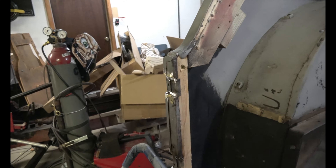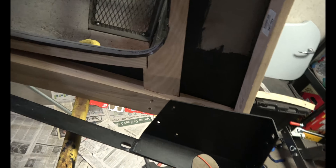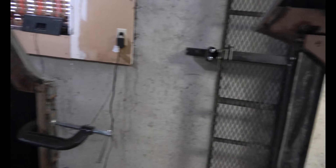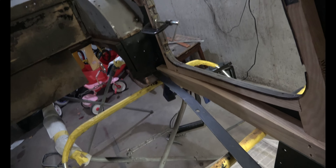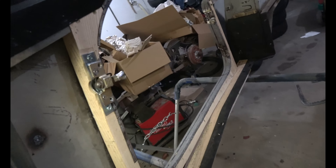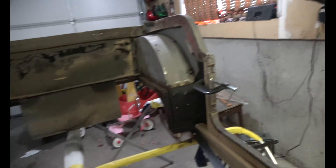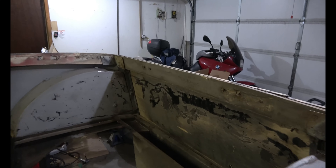It's not perfect yet — that's body work and a little bit more metal work. The door fits. Then I went on to the driver's side and started putting the wood together. I've got a few more screws over here and I've got to nail the skin on all the way around. After I get the driver's side done, I'm going to fit the driver's side door. Once that's all fit, I'll refit the passenger door and make sure they're both working fine with the crossmember, then move on to the wood in the back. I wanted to get the front all stable before moving on, because it was pretty clumsy without all the wood here.